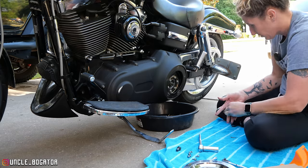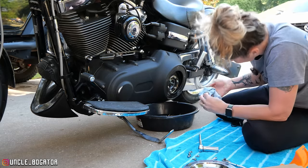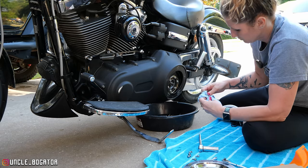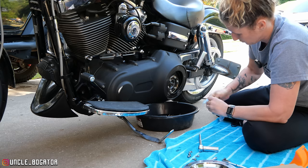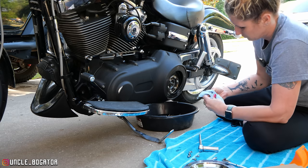Yep. All right. How's that drain looking? And then look on the tip. Well, you've already cleaned the tip. I'm sorry, I should have told you earlier because those are magnetic. They'll pull out little scraps. Make sure you get that off. Because inside of there, you've got a big old fat chain that turns your compensator, your clutch plates, your flywheel or whatever that is in there.